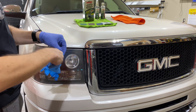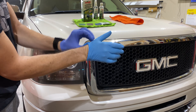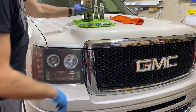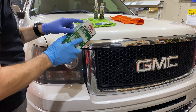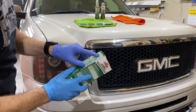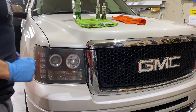Okay, let's get our gloves on — two different colors so I can remember which hand is left and right. First, wash the headlights to remove surface dirt. If the lens to be restored is next to painted areas, use masking tape to protect the paint, so let's take care of that.